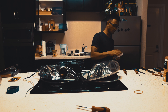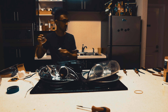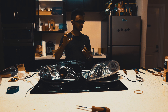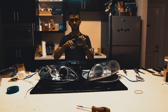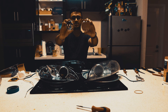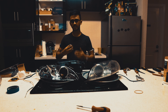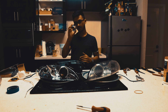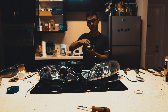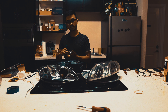The new Morimoto projector lens is ever so slightly shorter in diameter than the stock lens. Here we can see a stock SC300 lens, and here is the new Morimoto lens. The only difference is that the stock lens is translucent - you can't see all the way through - while the Morimoto is transparent. Modern cars have a very sharp cutoff point, and if you want that, this is the lens for you. Since it's slightly smaller in diameter, it would normally shake around, but since we're placing our halo into the housing, it will fit perfectly.